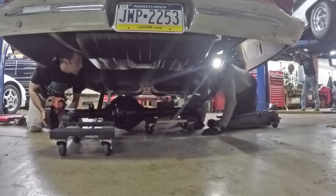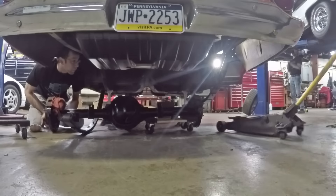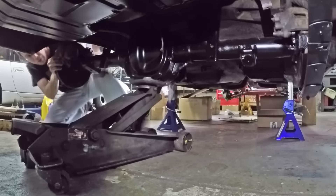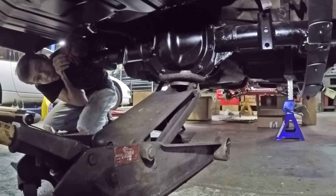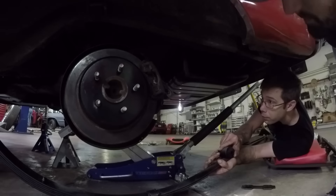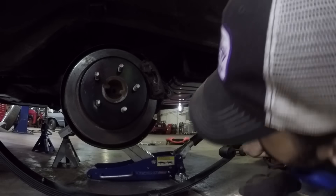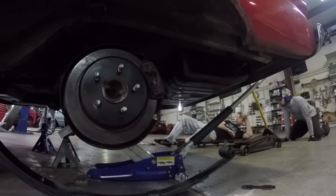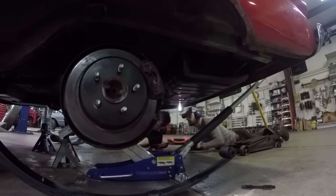It's the next day, and this day was a bit of a downer — the Ford 8.8 1998 Explorer rear end's spring perches aren't in the right position. I should have seen this coming: who'd have thought that 1998 Explorer spring perches on the rear end wouldn't line up with a car decades older? This delayed things about a week. Instead of grinding off the old spring perches and moving them, we don't have time, so I'm going to order new spring perches and Bruce will weld them right where they need to be. This rear end is going to end up with one set of spring perches that are used and one that isn't.